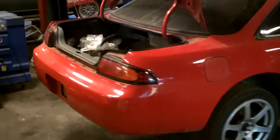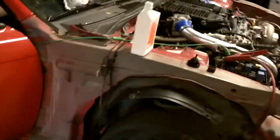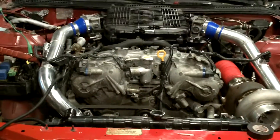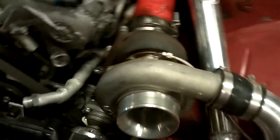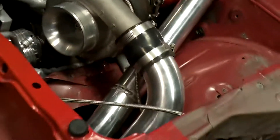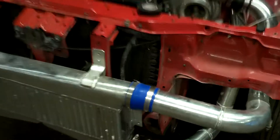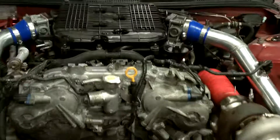This build is for Austin Miller. This is his 1996 Nissan S14. Got the motor built and installed, mounts done, transmission installed, all the wiring is done. It is a 2008 Nissan 350Z VQ35HR engine. We've got a Garrett GT35R ball bearing turbo. We've handmade the manifolds, downpipes, and all the piping. Got a 38mm wastegate, large inlet, two outlet front-mount intercooler, and 550cc injectors.